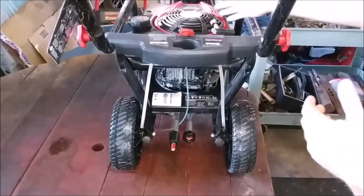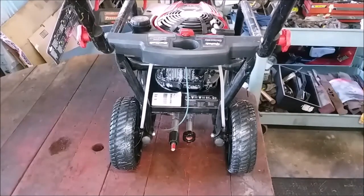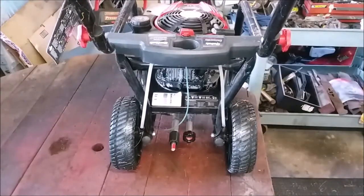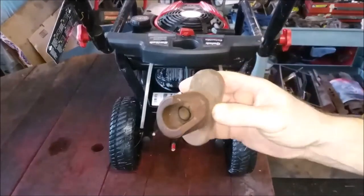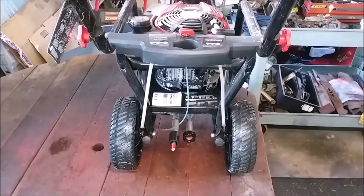Why is that? First of all, like all of these motors, unless you're going to use them for parts, they're short shaft engines, so you're not going to be able to use the engine on a lawnmower. It's parts for a lawnmower engine, but you can't put the lawnmower blade on this directly. It's a short output shaft, and I actually just did a machine. I don't know if it's going to make the web, but a guy used a longer adapter. I'll show you. And it broke the adapter, and the blade sat up way too high in the deck, and then you've got to drop the deck down real low, and the cut height's all wrong, and the deck skids the ground, and it's a pain in the neck to push, and it's just wrong. Okay, so if you don't care, you can use it. I won't do it. So my attitude is that these are great engines for pressure washers.